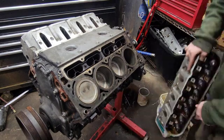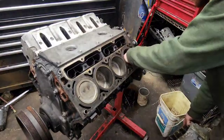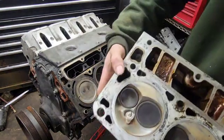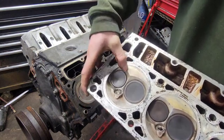Dirt on that piston. And there's our broken rod. You do have a ding in the bore, which sucks. Another one right at the bottom — looks like a rod smacked it. See that shiny part right there? There's no lip, so it seems like the head's still good. Didn't get hit too hard, just barely got nicked by the piston. You can see right there at the lower part of the bore near the bottom, at the very bottom you can see a little lip sticking up where the rod hit it, and about an inch and a half above that the rod smacked the cylinder. So this would definitely have to get bored over in order for the block to be used again. Bunch of scoring up top there too.